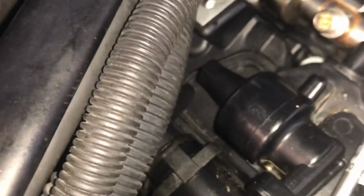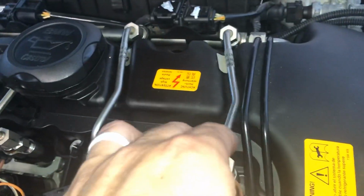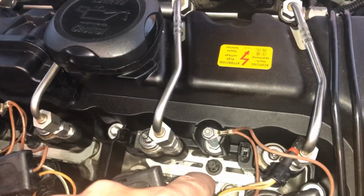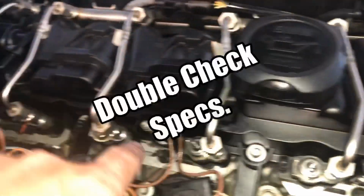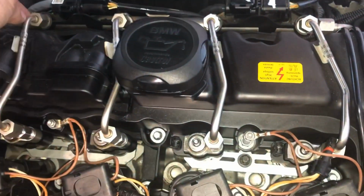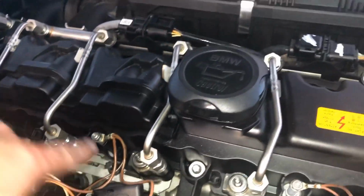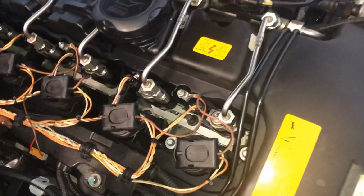That's about it. All right, all the injectors are in. We left the rails loose just so they could flex a bit as we tightened these brackets down. Tighten this side first. They're all started, obviously, but I tighten these first, and then we move to the main supply rail. And you want to back these up too, because you are getting them pretty tight. You don't want to be wrenching on your injectors too much. All right, they are all in, tightened down.